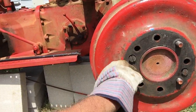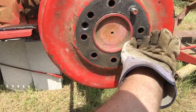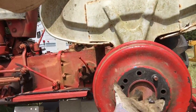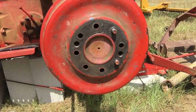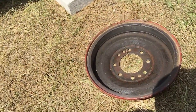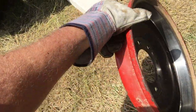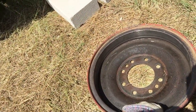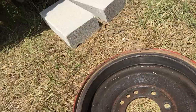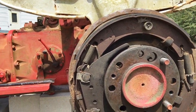The way you get the drum off: there are two screws right here — see that one and the other one right there. That's what holds the drum on. I'll take it off — okay, that's the brake drum. At first I thought the brake shoes had dug into the brake drum and created a lip. There is a lip on here but not much of a lip. I got the drum off and this thing's pretty hot.